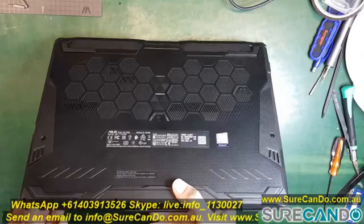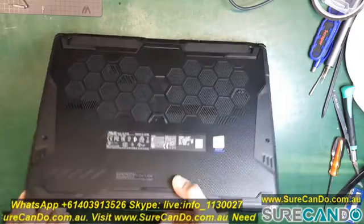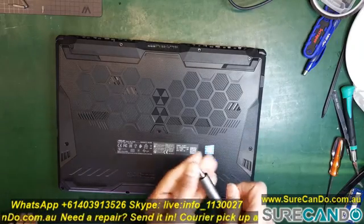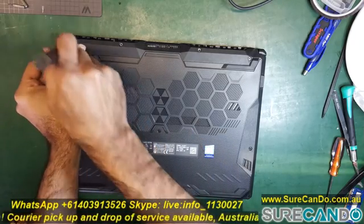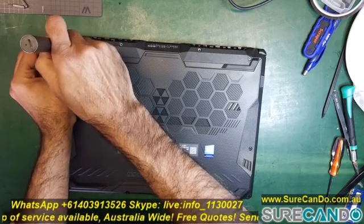It's like the ones they use on iPhone batteries, where you can pull the tabs really long all the way. It's actually on the bottom of the LCD. You will see me attempting to use hot air, just to soften it. I didn't realize there were tabs, but I did figure it out early on, and just pulled the tabs and the LCD came out of its position.